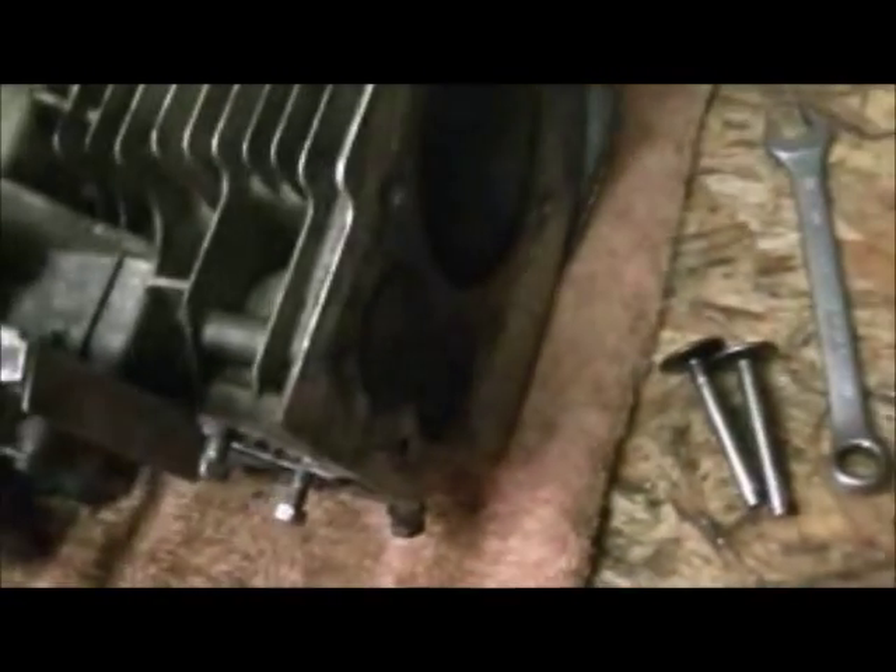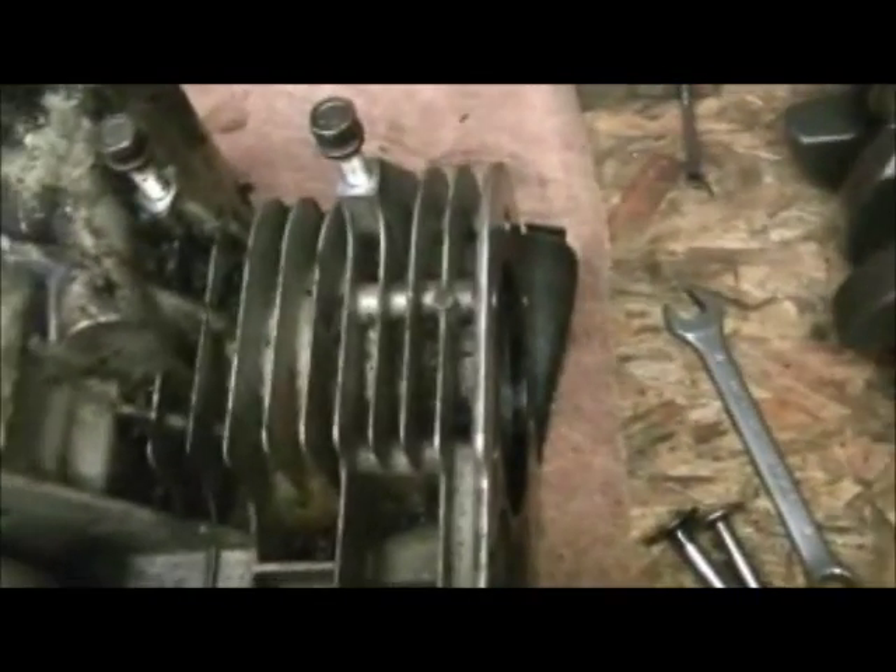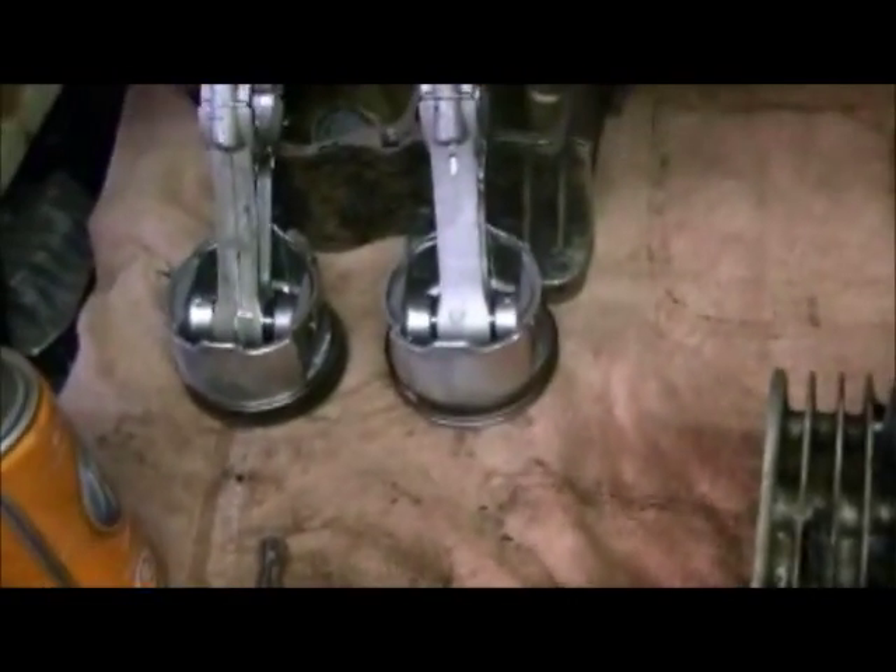I'm going back to the opposed engine. I'm going to get the valve covers off next, relieve the valves, take the valves out, or at least get the valves out far enough so I can work on the engine better — so I can get the lifters to go all the way back in, so I can get the crank in, get the camshaft in it, and so on and so forth. But other than that the motor looks good. There are no issues with this motor anyways — this motor did run, it just had low compression on one side. That's also why I'm going to freshen it up a bit with the pistons. I found an extra head gasket right up there.